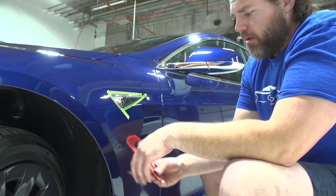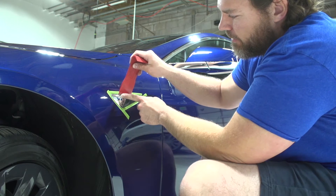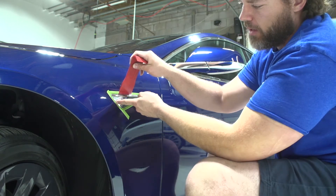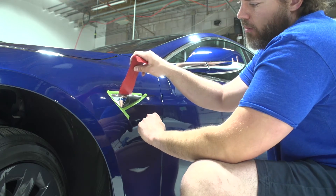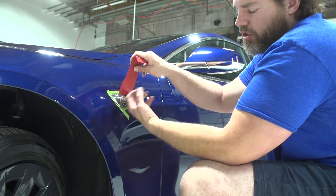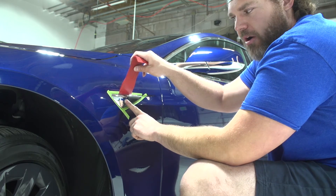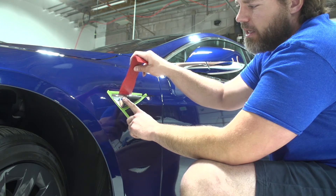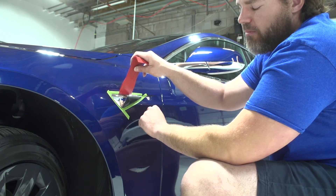Take the pry tool and put it right at the top around the edge. Also stuff your hand up inside — there's a clip on the inside that you push with your thumb. Push down with the tool but not too forcefully and it should just pop right out. You'll hear a loud snap. I have broken these before — they are fairly expensive, about $125 a piece, but if you break it go ask Tesla for a new one.